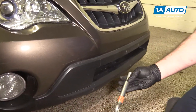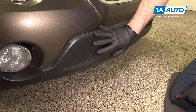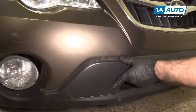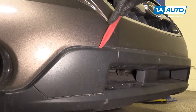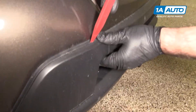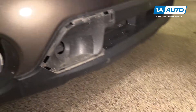If you need to have your vehicle towed, there's a towing eye included in the tool kit. You'll need to remove this cover. You can either use a wide flat-bladed screwdriver or a plastic prying tool — you can get these from 1AAuto.com. Slide it back behind here and pry the cover off, then put that aside so you don't lose it.